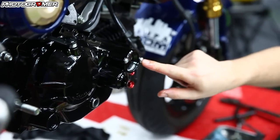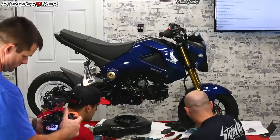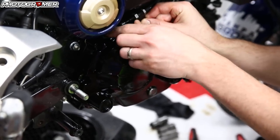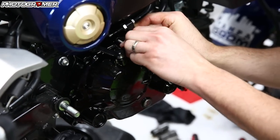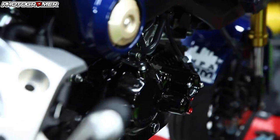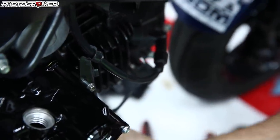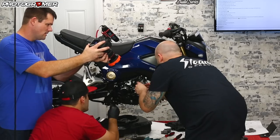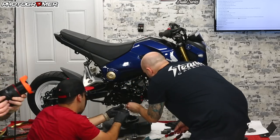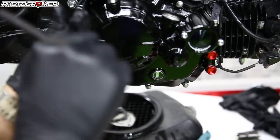What I like to do is get these bolts started — it is easier to get this in there when it's dislodged, but in an effort not to dislodge the plunger and the release arm, I just get these guys started. There are little retainer clips where this has to go through that hold the wires in place — make sure when you're putting her back together you line everything up. These bolts are torqued down to nine foot pounds, but these are also ones I've snapped before, so be very careful. Maybe an eighth of a turn past hand tight.